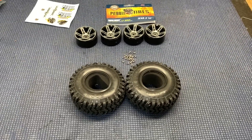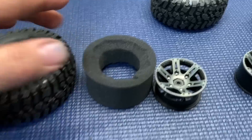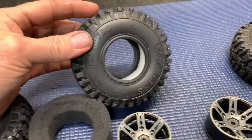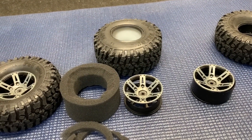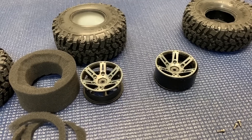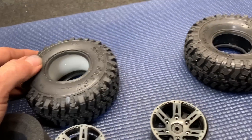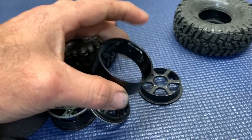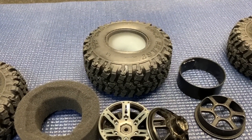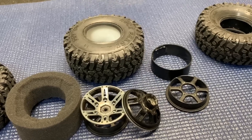It's been about a week since I started mounting these wheels and tires. These foams when they're all square - I had to cut them like this to try to keep the foam out of the beadlock area, but it's almost like the center of the tire is just a little bit too large. I'm sure this is just a compatibility issue between the tire and the wheel. I even put them together really loose with long bolts and stuck them in the freezer hoping the rubber would contract just a little bit, but that didn't work over days of tightening a little bit at a time.